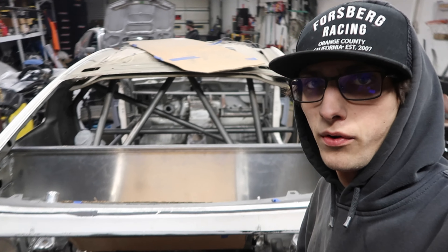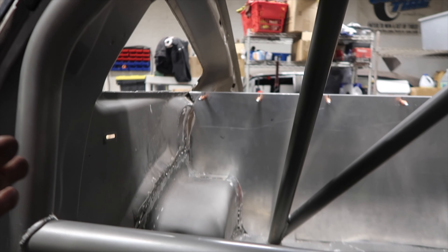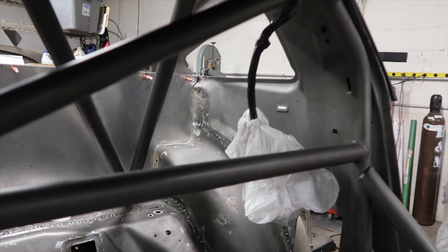It's a lot later now - I forgot to pick up the camera and I've just been working away slowly on the first part of the firewall for the rear rad. As you can see sitting in here I've got some cleco clips holding it on right now. I'm not going to lie, this is not my proudest bit of work, but I don't have the most sheet metal to restart. I debated restarting a lot but to go get more aluminum I'd have to drive like four hours round trip, so I'm not going to say it's perfect because it's not. I'm sealing it off with aluminum ductwork tape - like the tape they use in your house on heating and ventilation pipes - so all those gaps will be mostly hidden. That first wall is done for right now.